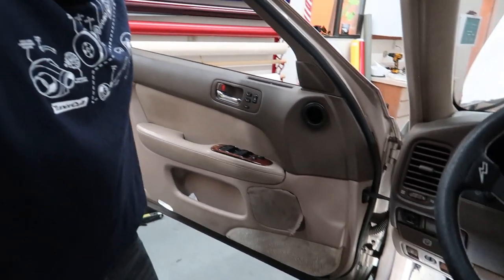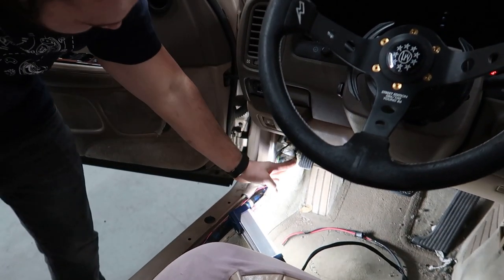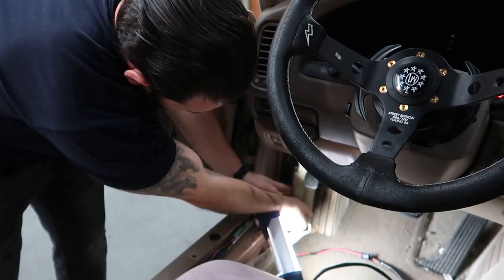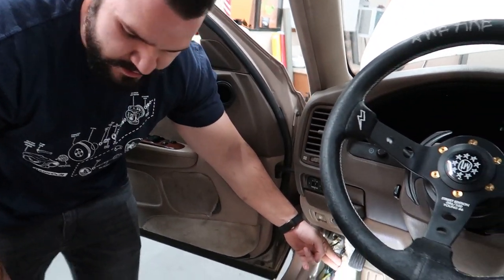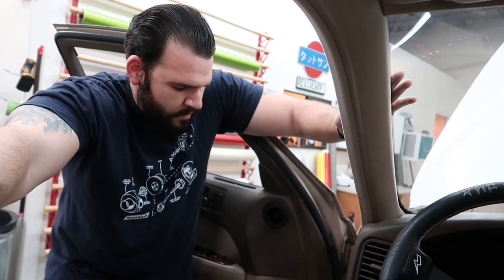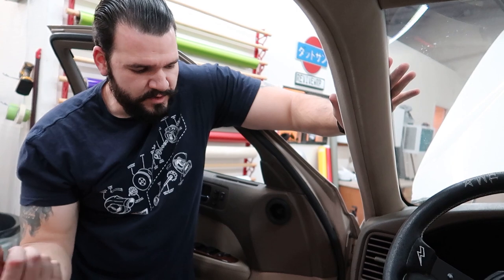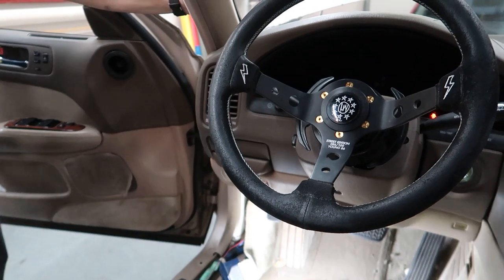Pretty much all I did was find an ignition source through this kicker panel and tapped into that. I heat-shrank the butt connector and now you should be good — the bags will start once the car is turned over. That's why I went with the ignition source. You can also use an add-a-fuse setup: you pull out a fuse, put the fuse holder back in, and wire it up. The ones we got were too small so we did the alternate method, but either way works for turning on the bags with the ignition.